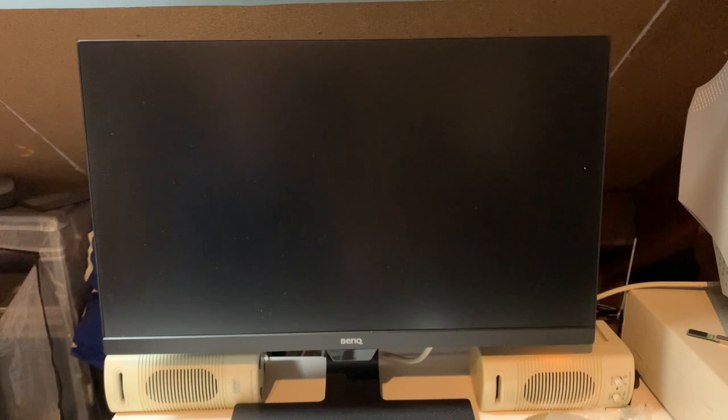We're also going to witness one of the downsides of not using an official Mac EFI video card. And that means no boot screen. So we cannot use the boot picker, we cannot get into recovery. For all of those different things, you will need a proper Mac video card. Now, I have two. I have the 5870. And I still have the original 8800 GT for this, so it shouldn't be a problem.